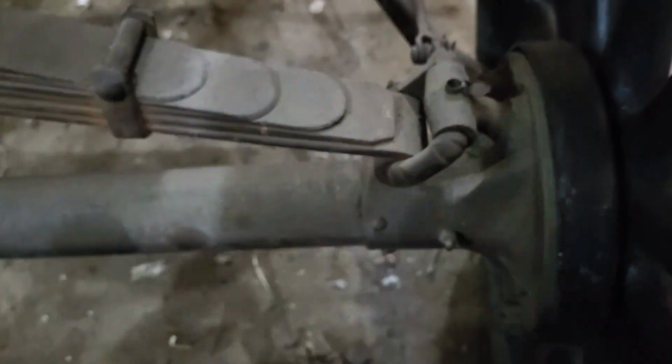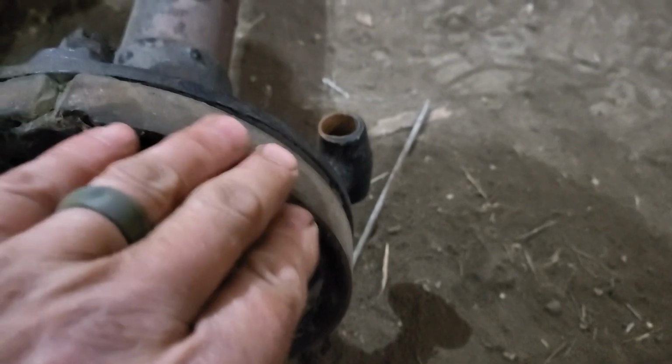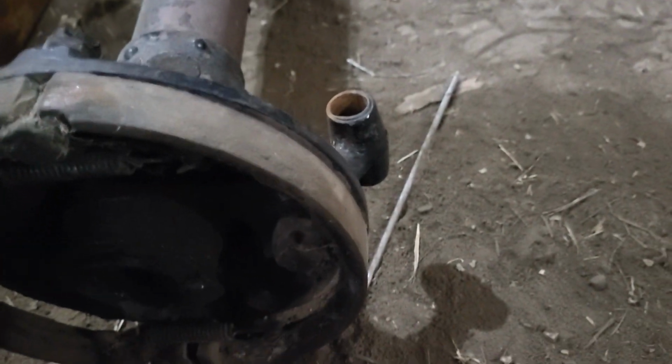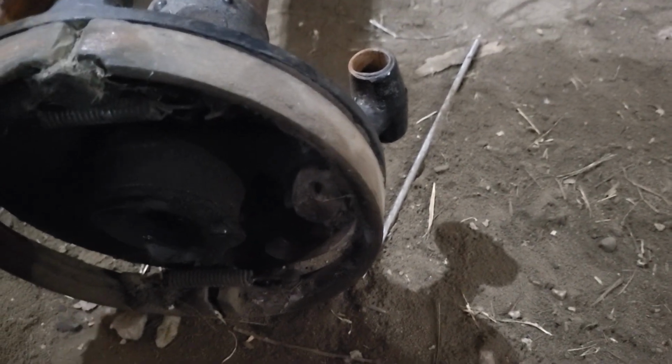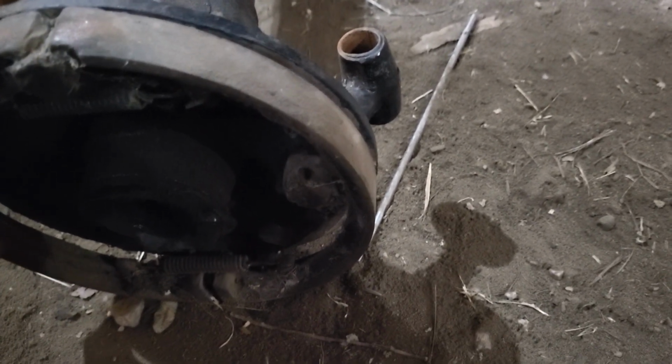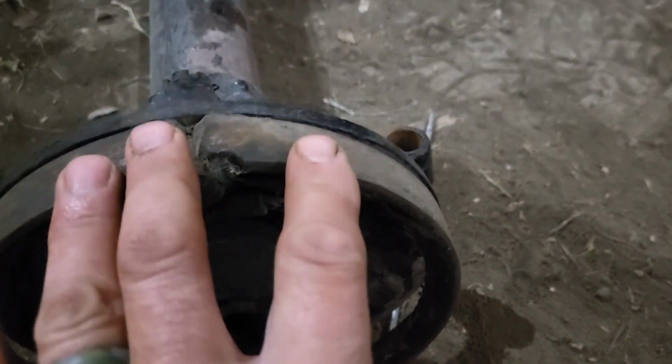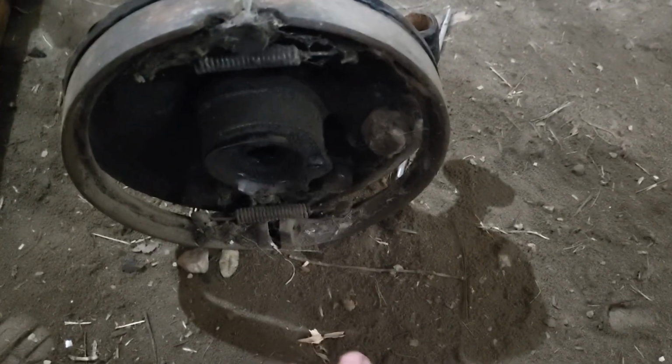And the other interesting thing, when I pulled the wheels off, that whole brake mechanism is gone from inside there. I'll show you on this one here. So inside there, you've got these brake bands. You can't really call them shoes because they're just metal. It isn't actually a brake. It's just to hold the car. It's a parking brake, kind of, sort of, but it's just metal on metal, so it really doesn't hold a heck of a lot. But this is not in that other car. Like these parts are totally gone.